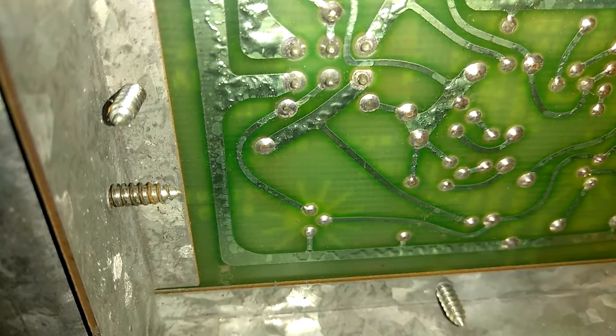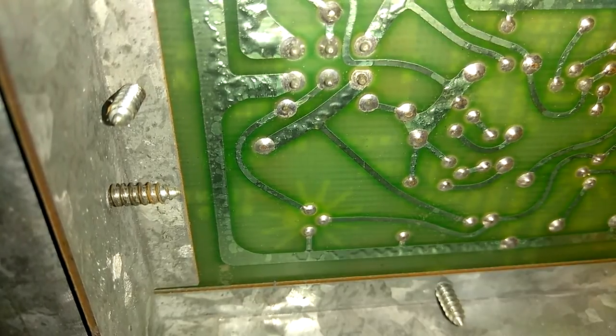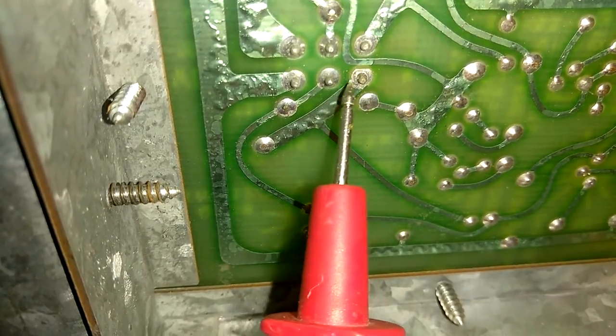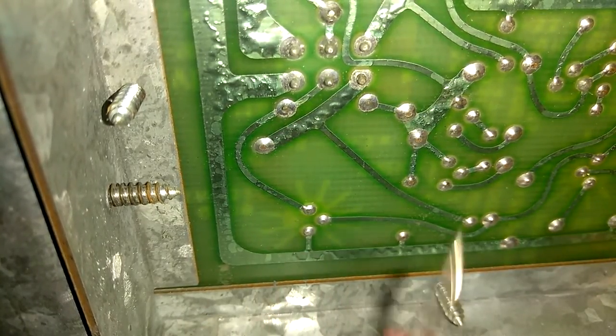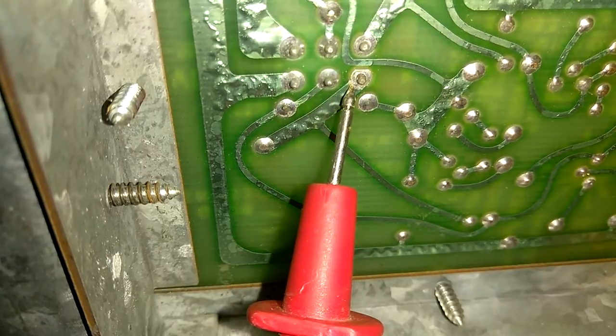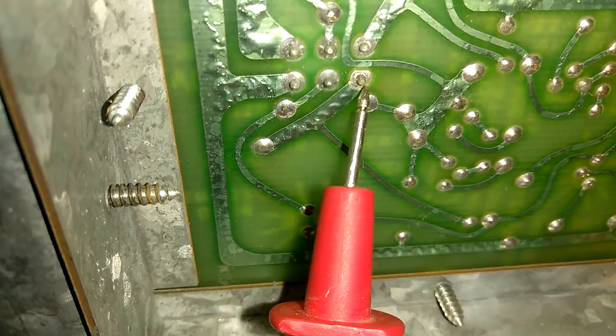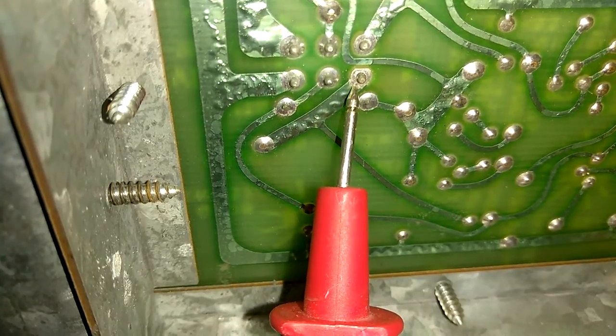I turned the monitor board face down so I could see the back. One thing to look for is cold solder joints before you get into crazy repair and start tearing everything apart. You should check for cold solder joints on any plugs all across the bottom of the board. Right here I can see I have a cold solder joint, and on the other side of this board is a plug that connects to my transistors that I first suspected were bad. I'm going to go ahead and reflow this and hopefully that'll do something.